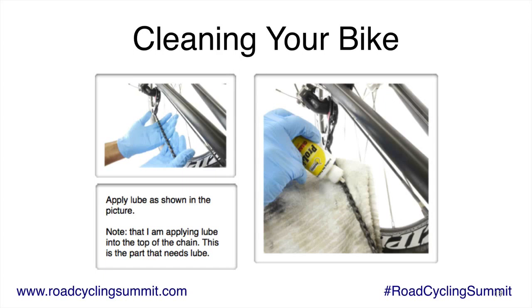So if I'm in a rush, I'll just go kind of down the chain, but I know I'm using way too much lube. You want to have just enough, but not too much. So the real way to do it is to put one drop in each link. It doesn't actually take as long as you think. It only takes about a minute or so to go around the whole chain. It's 120 links roughly.